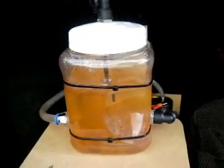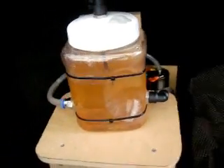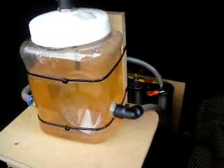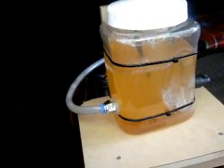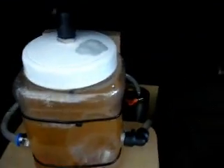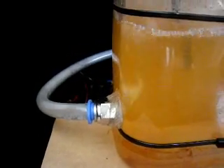The tube on the left is the gas coming out of the cells, and the tube on the right is the electrolyte flowing back into the cells, so it acts like a little pump. I've just turned it on so it's not bubbling huge, but it does get a fairly okay amount of output. I measured it at 15 amps - it got 1 litre in a minute 20. But it was low voltage for that test, down to about 9-10 volts, so I haven't tested it at proper car voltage.